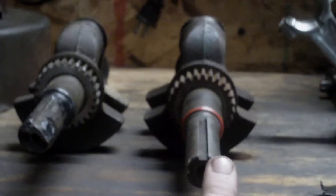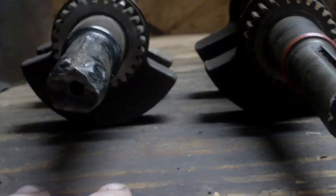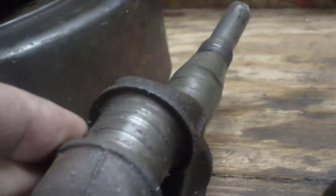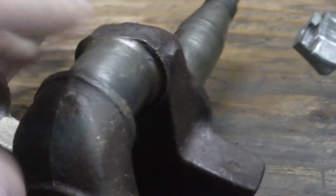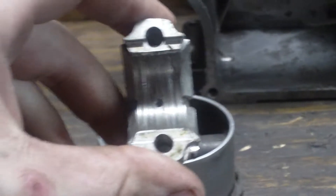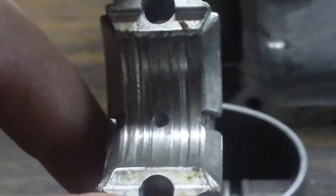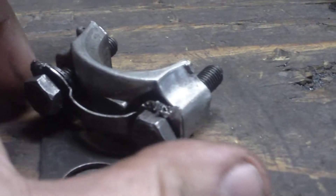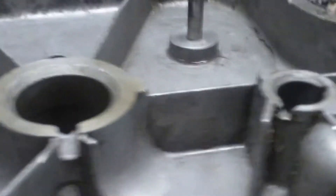The first modification I'm going to be doing is putting in this crankshaft. The stock one has been hit or something — it's probably bent and it's scored real bad, see there. This one I got here I could probably clean up pretty good, it looks pretty good. The connecting rod out of the original scored really bad, like it's run with no oil at one point. There's the end cap of it and the oil slinger.